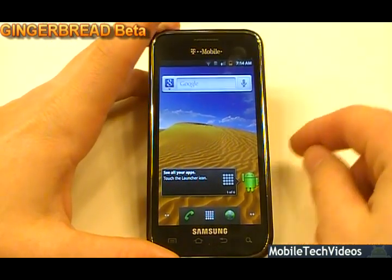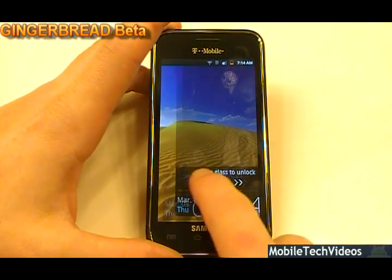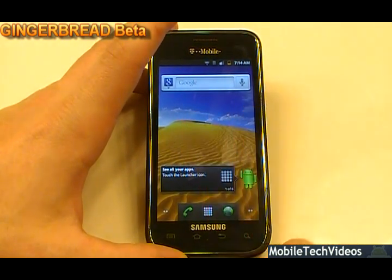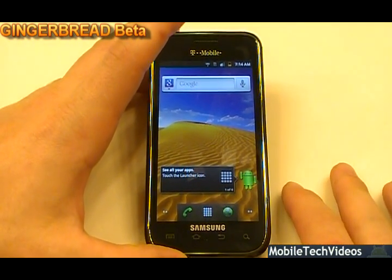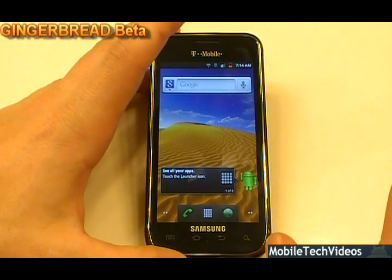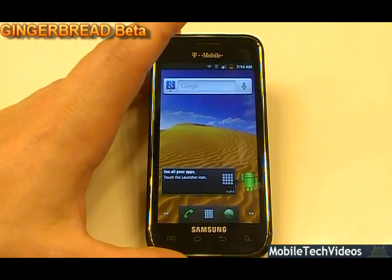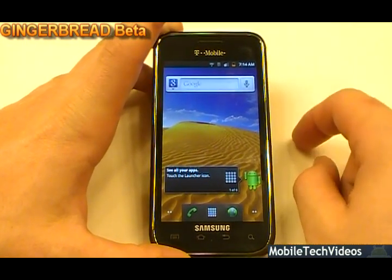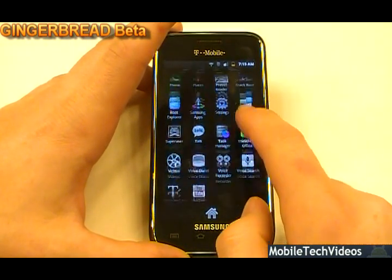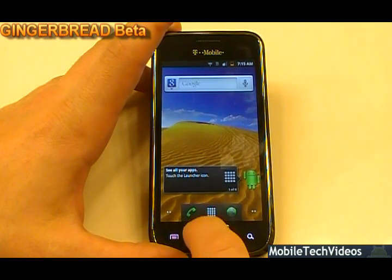We've already elected to drop in the nicer framework res.apk. We get the awesome cool turn-off screen. You can check that out at the original thread in the description below — I believe it's in the second post of the thread that teaches you how to drop in the new framework. Don't write a script for this; I thought about doing that and had nothing but headaches. It would get halfway done, I'd have already deleted the current framework, and then I'd get force closes. At that point you're gypped and can't reboot the phone without a framework. Just use root explorer or similar tools. You do have to have BusyBox loaded to use the copy commands, so I recommend root explorer. Linpack and Quadrant scores are about what you'd expect from a 2.2, but the experience itself is actually very zippy — I'm really impressed, with little to no lag with launching.